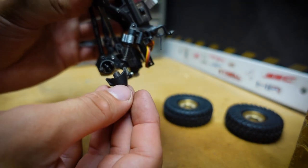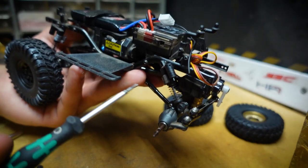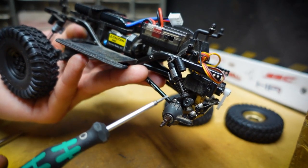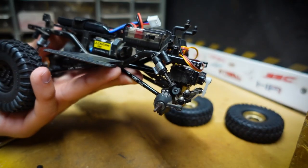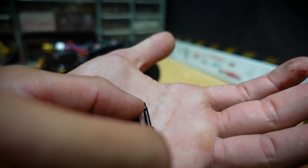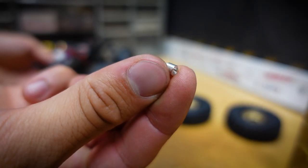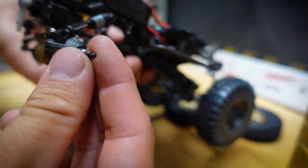It's in there snug - line up your dog bone and reinstall. A warning before you put everything back together: the screws holding the steering knuckle - the one up top and the one down below - if you over-tighten them they will create bind. You have to make sure when you tighten it to back off a couple turns because your steering will be greatly affected later on if you don't. Don't forget to put your spacers in up front like you did in the rear, then slide the pin in and you're all set.